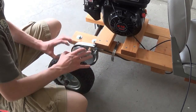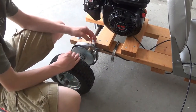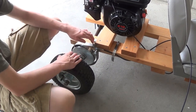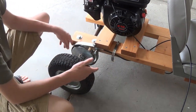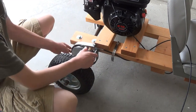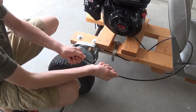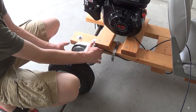You need the outer housing to be secured down — if it isn't, your brake isn't going to work. When the cable is pulled, it clamps around the brake drum and locks the whole axle. Now, when riding off-road I honestly don't use brakes that much; once you let off the gas the kart pretty much comes to a stop on its own through friction — kind of like a boat. The hardest part is connecting the cable correctly, and just remember the outer black housing cannot move.